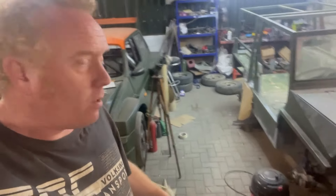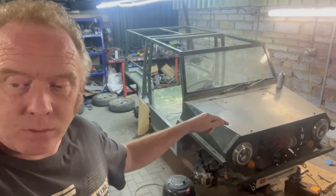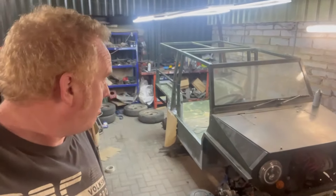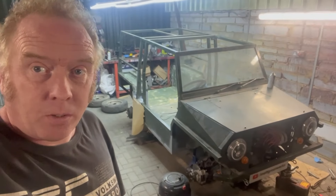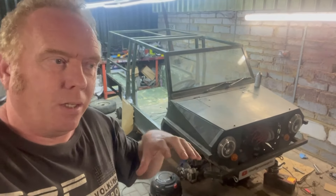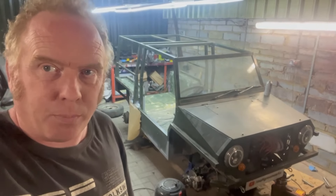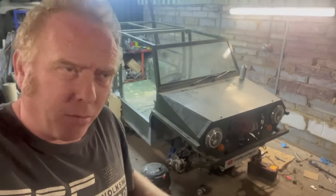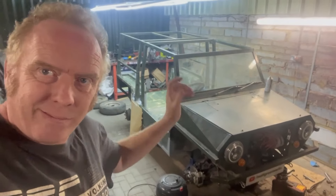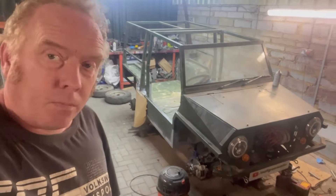Day Three - back down here Thursday evening. Saturday is paint day. At least wrapping the floor if I can get that done as a start. What I've got to do today is take the seat belt mounts out because I've got some stainless that's turned up, so I'm going to try and make some stainless seat brackets. I bought some extra three mil aluminium plate because I want to make some floor strengtheners where the backs of the seats sit - they sort of push down and bend the floor a bit.